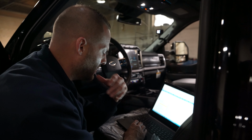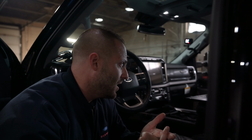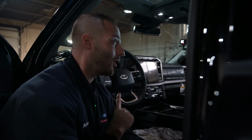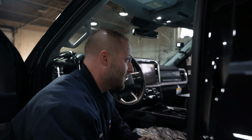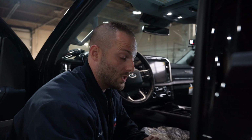So it's got a couple of things we need to do. We need to now run the vehicle until EGT 12, 13, and 14 are greater than 437 degrees. We need to then shut the truck off for 2 minutes, restart the engine, and then it says the dosing injection will begin and may continue for up to 5 minutes. Monitor the reductant injector duty cycle PID, which we can't, because you guys clearly saw that that PID could not be selected.